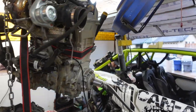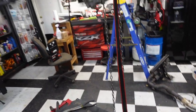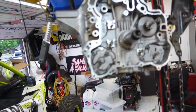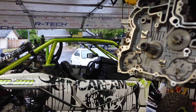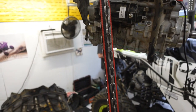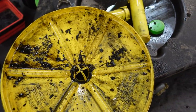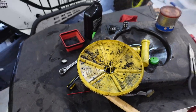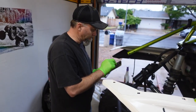We have the motor buttoned back up. We found a bunch of stuff — we put all these new oil sieves in, one was plugged up and caved in. We had an oil pump frozen because of plastic from the plastic gears. It broke, we cleaned out the oil pump and the oil pan really well. And again, for the 47th thousandth time — that's all the plastic we managed to capture. Some of it got away, but that's a lot of plastic.